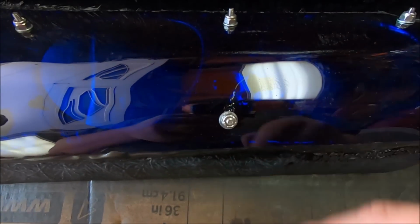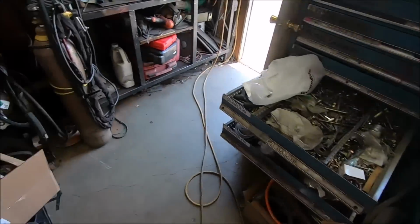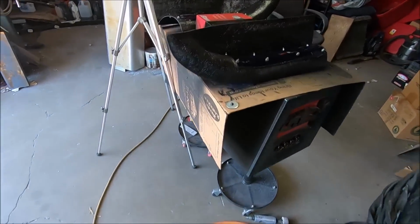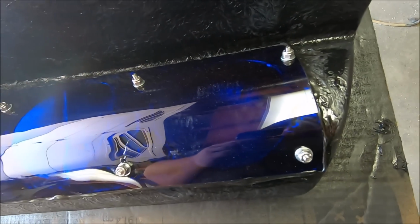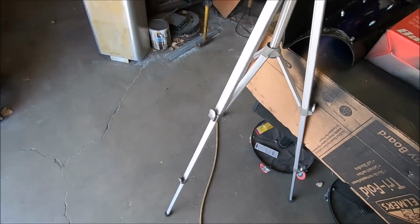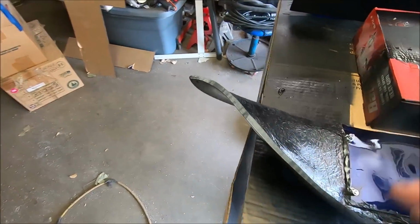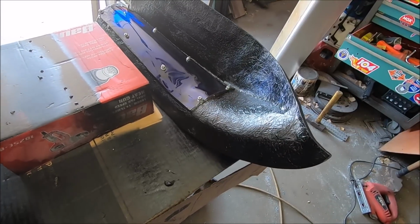Alrighty, well, this side is attached, seam sealed, epoxied in place. Filled one of our little mistake holes. No issues yet, knock on wood. So that baby ought to look pretty good when it turns out. We're going to let the seam sealer dry for a few days. I wanted to avoid using seam sealer, but with the epoxy, things weren't forming 100% how we had them on the outside. Because we formed them on the outside, we should have done them on the inside, but that's hindsight.